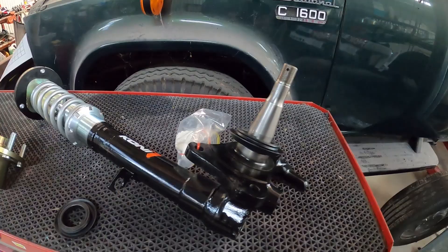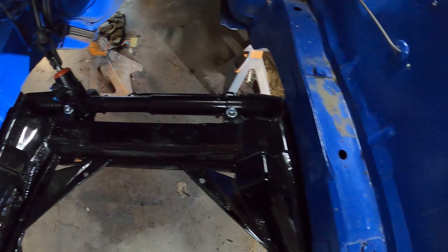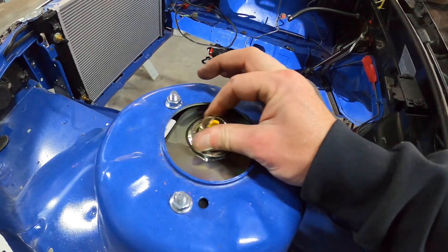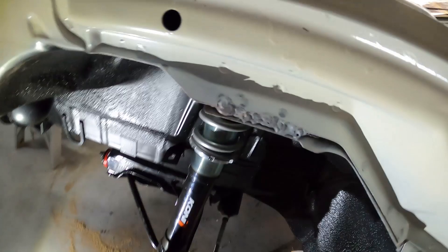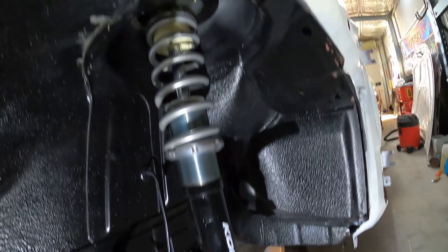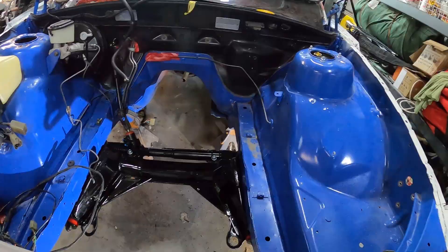I've just done a bit of a mock fit-up here of our power steering rack — as you can see, that's all in and mounted up. Here's the top of our struts — you can see all that adjustment will be fantastic for going negative camber and all that sort of good stuff. That's looking beautiful. Nothing's done up tight, I've just mocked it up to make sure it all hangs together, and it certainly looks like it does. We're all attached to our K-frame, strut assembly is in, power steering and tie rods are in. Now I've just got to do our sway bars — we're making some good progress here on a Saturday.